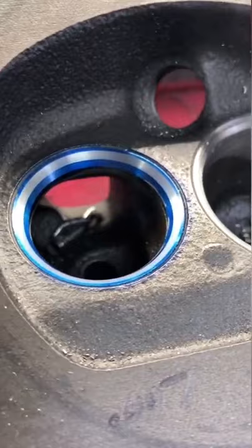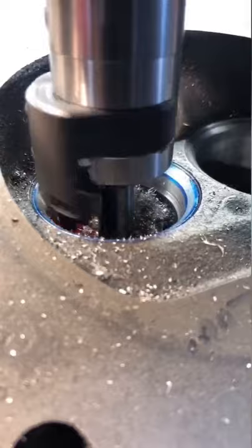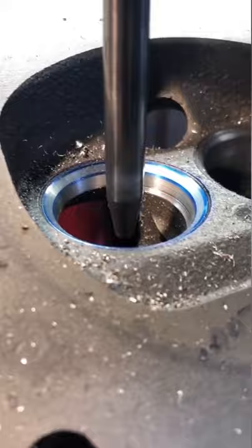In addition, it gives me a visual of the location of my seat angles on the valve seat, so that when doing any follow-up cutting operations like this, I can see how close I am to cutting into the seat angle. Again, everybody has a different opinion about lapping valves, but my opinion is that there's no reason to lap the valves if your machine work is precise and accurate.